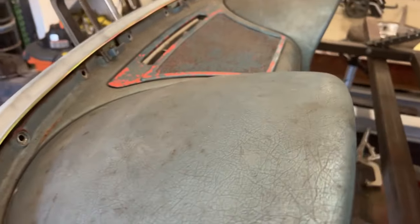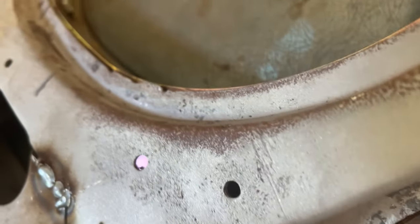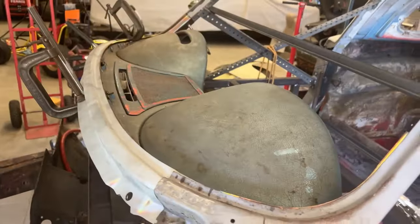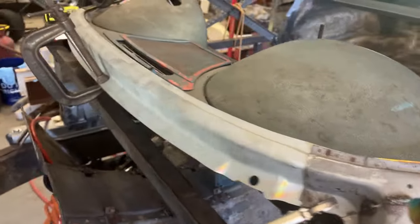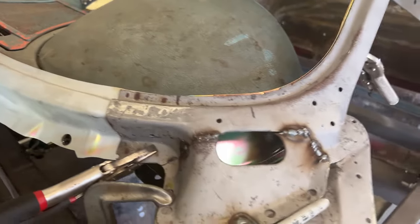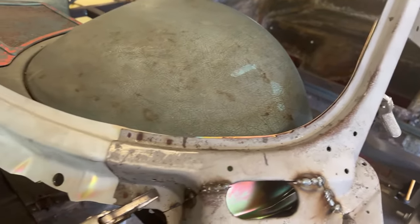I went ahead and put the dash in there to make sure the holes line up. The two end ones are a little tight, but we'll make them work. I'm all the way up as far as I can go right here and can't move this further — it'll make it, just a very tight squeeze. I'm pretty happy with this. I'm going to get the dash out, make my marks, drill my spot weld holes, and probably blast this plating off since it doesn't hold paint well. Then go from there.